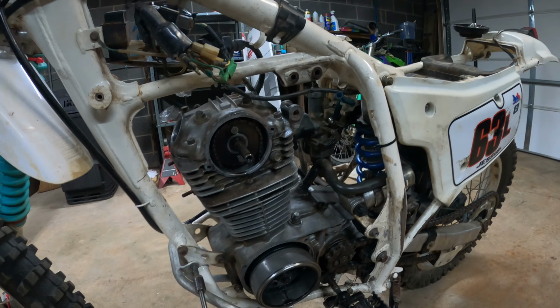And to install this bad boy, you want the exhaust valve pointing forward, you know, towards the exhaust. And you just line it all up. There's something there. Give her a couple jiggles. Oh, there she goes. She's going home. Now I'm going to fight with another C-clip for about 30 minutes. So. And she's in. So I like to keep the ring gaps one pointed this way and the other pointed that way. And now I'll just gently put this cylinder on.